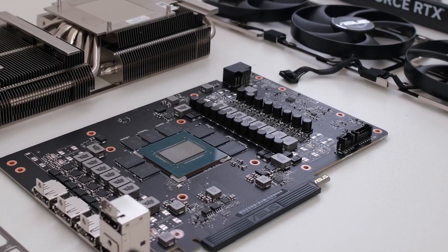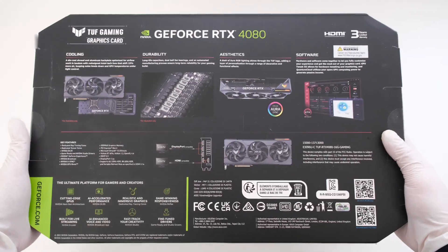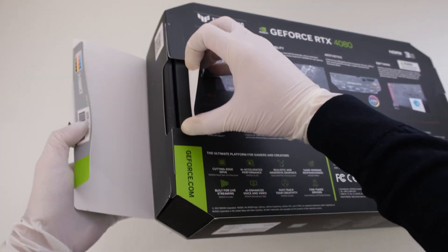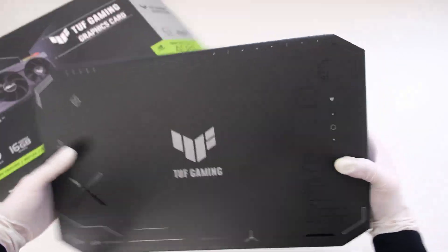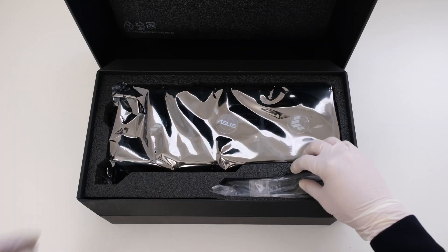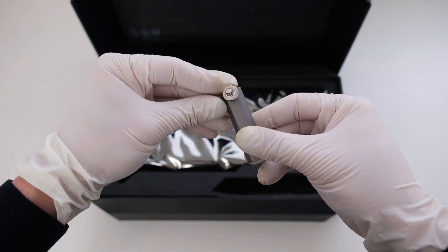This is the Vector Network. Let's begin. The ASUS TUF GeForce RTX 4080 is equipped with NVIDIA's AD103 4nm graphics processor with an A-plus-3 VRM architecture and 16GB of GDDR6X memory. What's in the box is a Velcro strap, 12V high-powered triple 8-pin to 16-pin cable, and a GPU anti-sag brace.